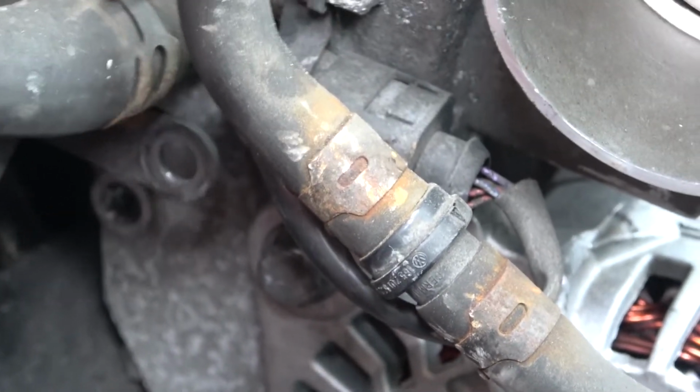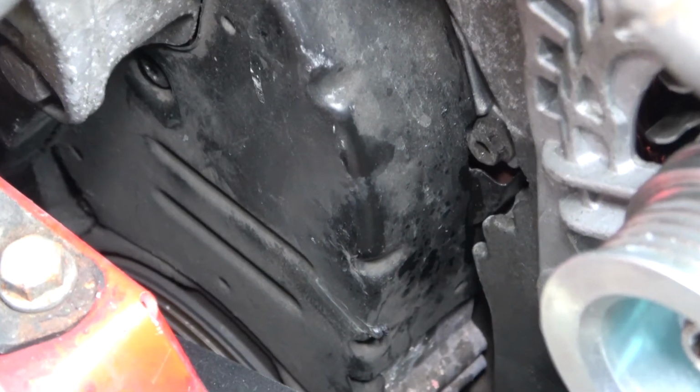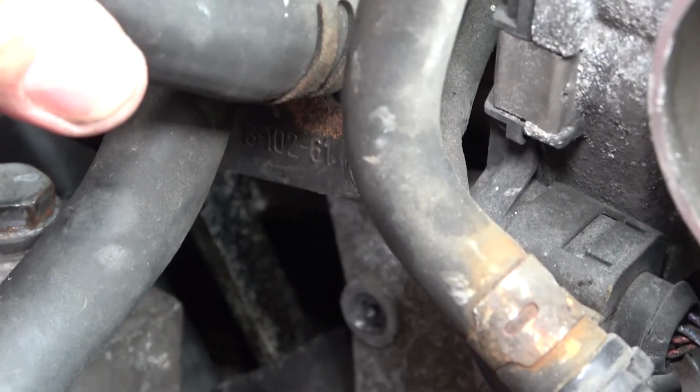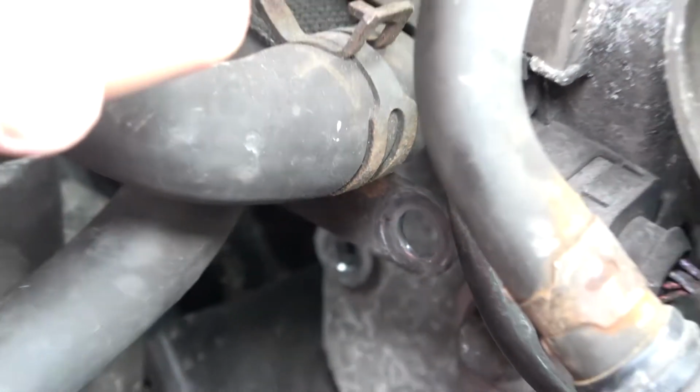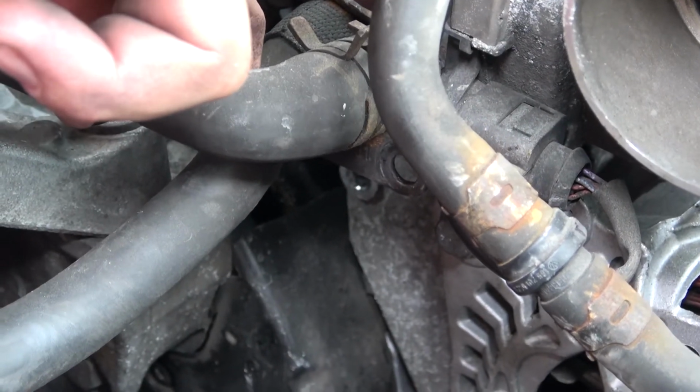If it goes behind, flush with the block, you will get issues and it will smash itself into this casing down here. You can probably see where I made that mistake when I was doing the timing belt, and there's like a big old burn mark on that engine casing there. So yeah, that plate has to be away from the block and on the tensioner side.